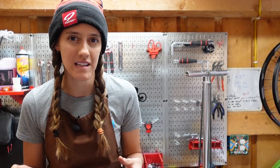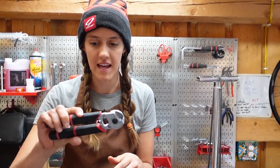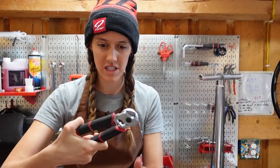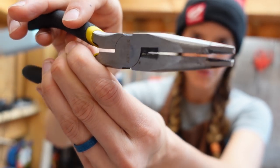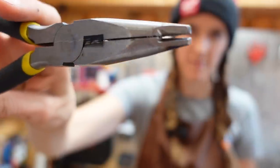The last task we want our beginner mechanic to be able to do is changing and replacing cables and housing. This is slightly more complicated than the other stuff, however it doesn't require many more tools and will save you a lot of money. Shops often charge a lot to replace cable and housing when it really is pretty easy. To do this task, you will need a good pair of cable cutters — it's a pretty specialized tool but definitely worth the investment. You will also need pliers or a crimper tool to close your cable end. We have a modified set of pliers we use as a crimper, with a cutaway in the front so you can easily smush and then pinch the cable end.